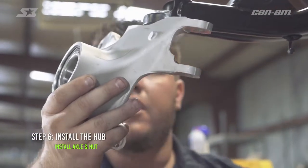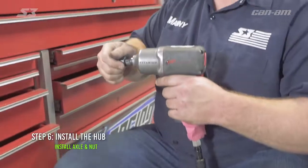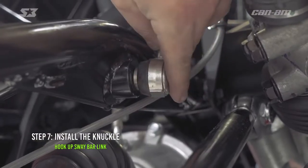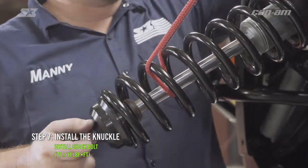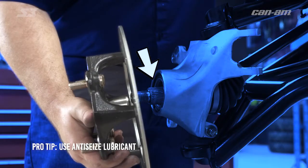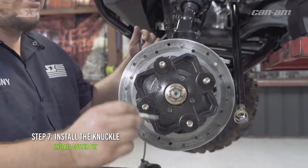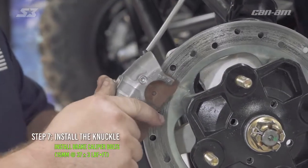Now we're going to put our A-arm up and we can get our axle back inside the bearing. Grab the lower A-arm, go ahead and stab your lower ball joint back in the hole. Once you do that, go ahead and take your 15 millimeter bolt, run it back through there, and tighten up the nut. Using your 15 millimeter end wrench and your socket, go ahead and tighten up the bolt. Now we can go ahead and hook our sway bar link back up, take the bolt, slide it through the hole, and put your nut back on. Now we can go ahead and get our shock back on there and put your lower bolt in and tighten her down. Now that we've got the lower shock bolt on, we can go ahead and put the rotor and hub back on. A little bit of anti-seize or some grease around the surface will keep it from hanging up on you later on down the road. Get your axle washer and nut and go ahead and torque them down. Now we can go ahead and get our cotter pin and get it back in there and work it back around the nut. Once you do that, get our brake caliper, slide it over the rotor, go ahead and get the bolts in it and tighten her up.